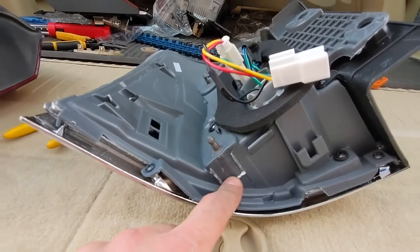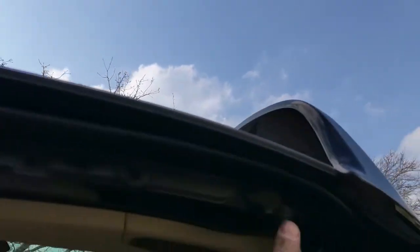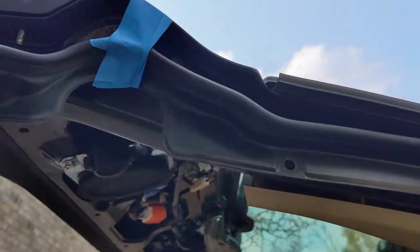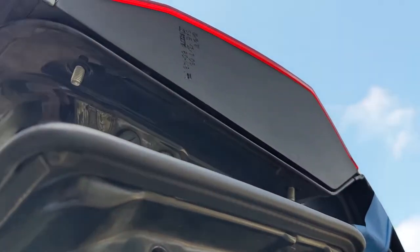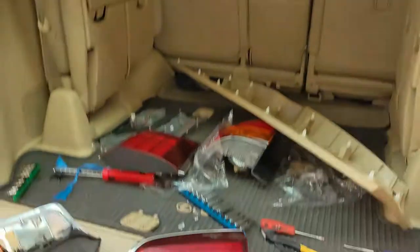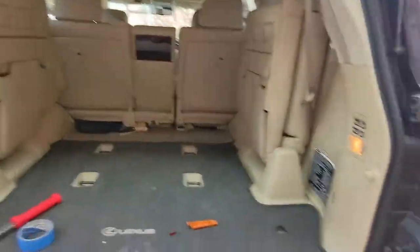Got that tab trimmed off. Let's get things lined up — I'll plug it in and then line it up with the push pins. Got this trim piece off with painter's tape there. I went ahead and left the last torx screw in; everything from there downwards I took off — that should be enough to get to all the nuts on these studs, which I've already got off. Now pry this guy off. That one is off. Let's get the new one on — lights on, nuts on, let's get the trim back. Now that that's done let's see what it all looks like.